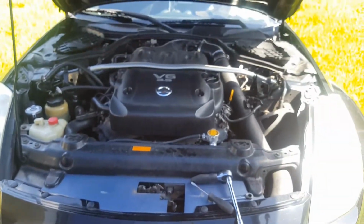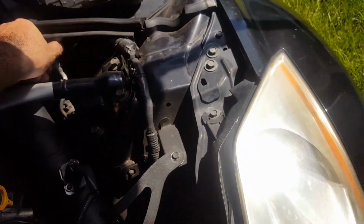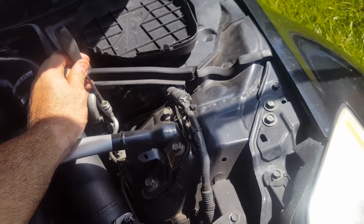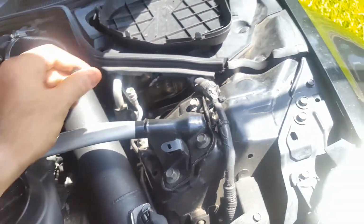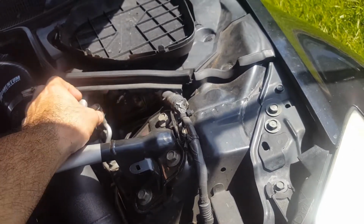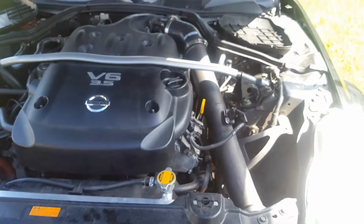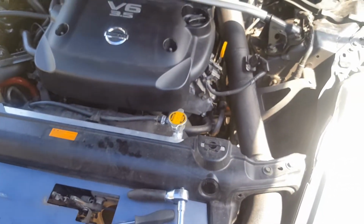And make sure, in case you do have gas, I don't, I can press the Schrader valve, and there's very little residual gas, just built up from the air. Even if you don't have any refrigerant, you're still gonna have air, like oxygen, in there. So I'm gonna go ahead and start taking stuff apart.